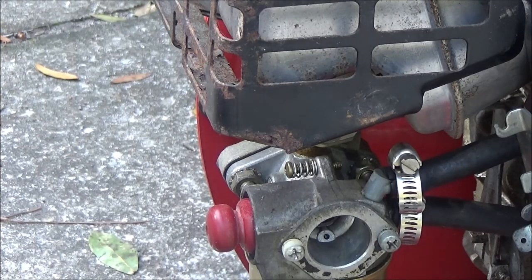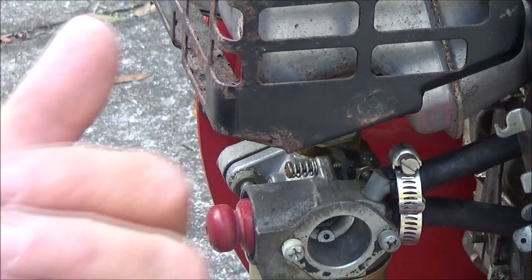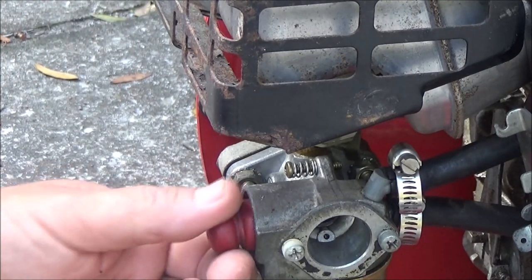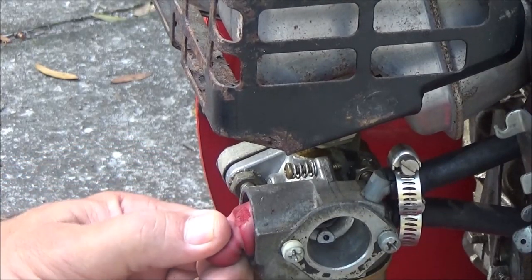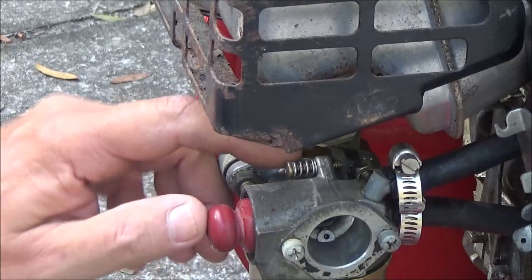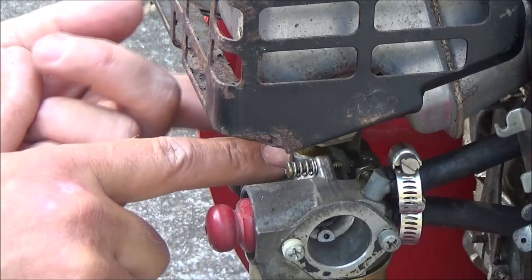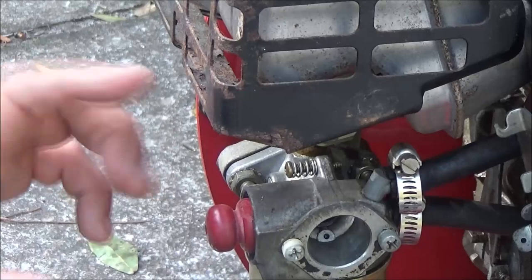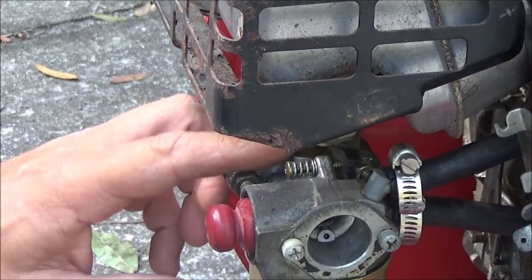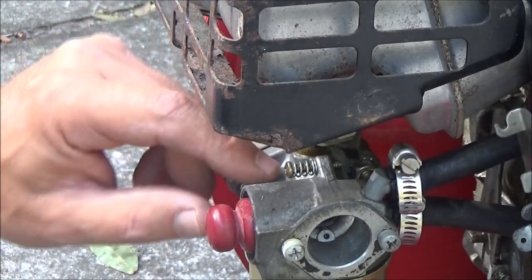You know what, I'm just going to go ahead and siphon it out. I'm not going to show you how I do that because you shouldn't be doing that. Okay, and then we'll take this carburetor off and we'll get it inside on the bench. I ordered some new primer bulbs. This one's not looking the greatest, though it was working. We'll check that out. I'm suspecting it may be sucking some air around the throttle here, but I'm not positive. Because when it was running, if you shot carburetor cleaner on here around this area, it would rev up, so that's telling me it was sucking air, I'm guessing, right in here.